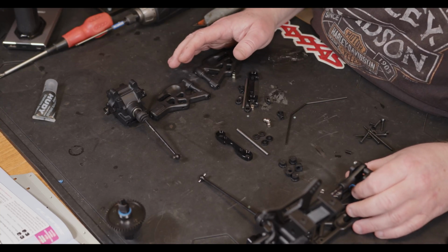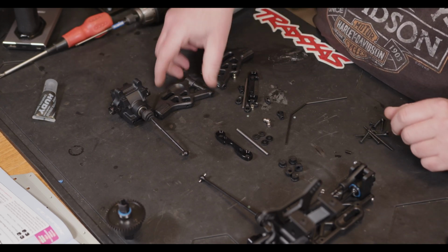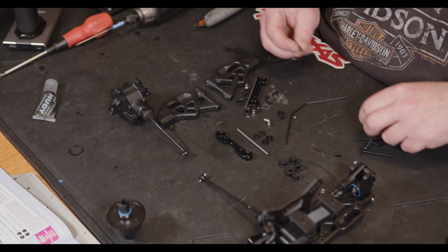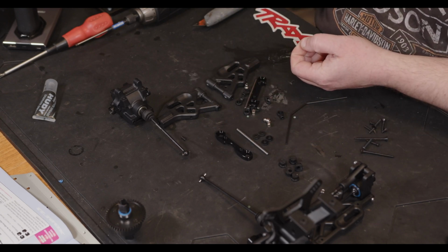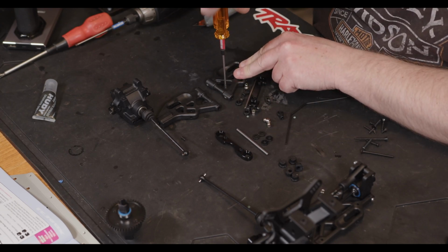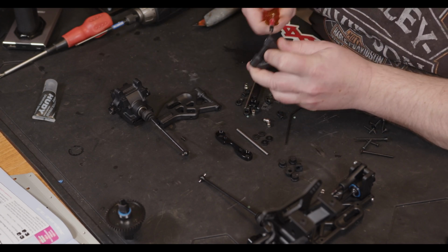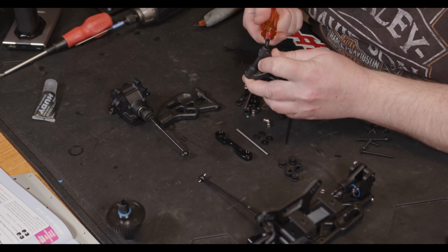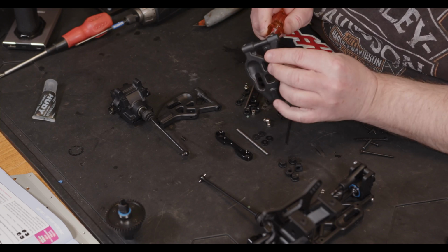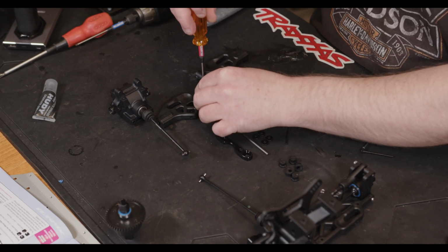Moving along with the XB8e, moving on to the front now. So front suspension wise, first thing we're going to want to do is get the tiny little grub screws. These are going to be a 2mm ball head hex head, sorry. And you're going to want to screw these in, and look at the instructions. I'm not really sure what it's telling us to do with these, because it just says gap 0mm. So whether it's telling us to just put it level with bottom, I suppose. But we can adjust that when we get it all put together.